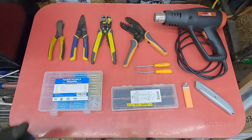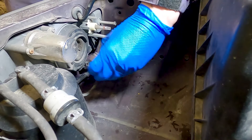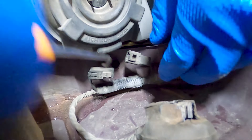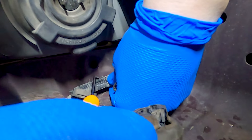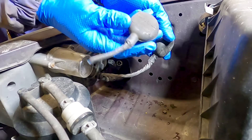That's all the tools, so let's get to work. Disconnect the battery before repairing or modifying any wiring on a vehicle. Start by getting the best access possible to your wiring. I'm going to remove the connector — there's a captive part of the wiring down here. I'm going to pull out this tab; it's held in by these little wings so using a hook can help pull them out. With the wiring freed up I have easier access to the offending connector.